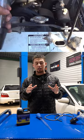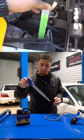You're gonna have your vehicle cold, pop the hood, open up the radiator cap. You're gonna get a turkey baster to get a little bit of coolant out to make room for this guy.